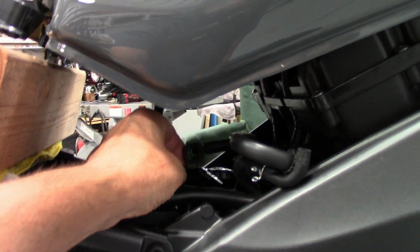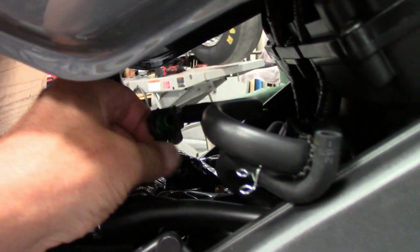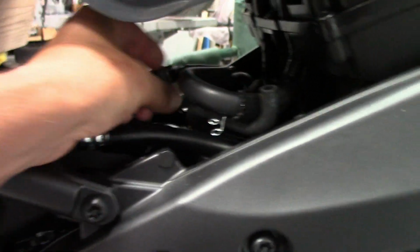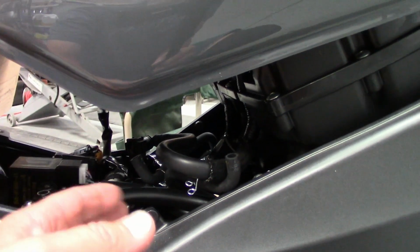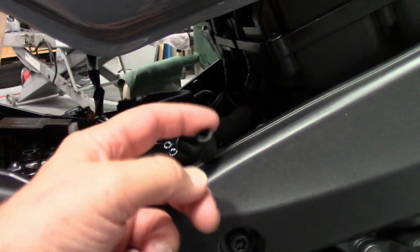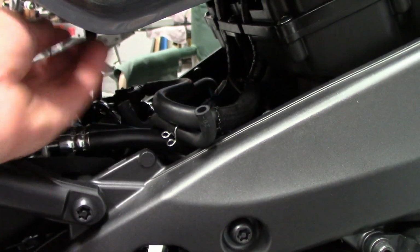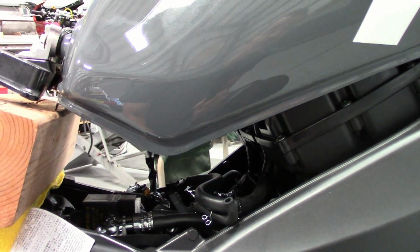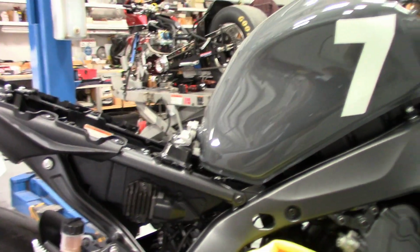And then you're going to clip on the fuel line and push the clip up and snap it. So the hose here and the hose here. And what's nice, you don't really have to mark them because they're kind of self-explanatory. The right one's towards you, the left one's on the nipple in the tank. In that order. So do all that. Let's get the tank bolted on.